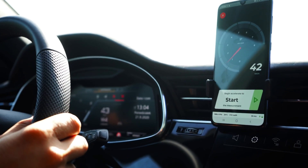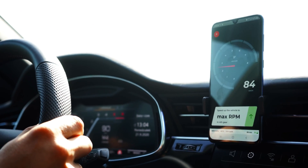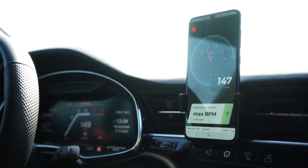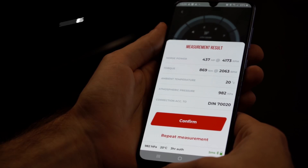You'll be asked to slow down the engine speed to a designated value and then begin acceleration. The phase should last at least 10 seconds before reaching maximum RPM, but you can customize these values in the settings menu to fit your conditions. After that, you will be asked to put the car in neutral and wait for the rolling resistance calculation. The measurement is complete.